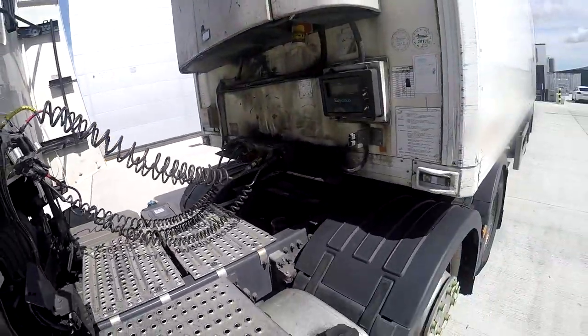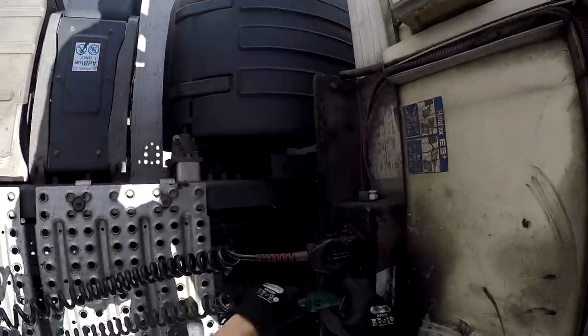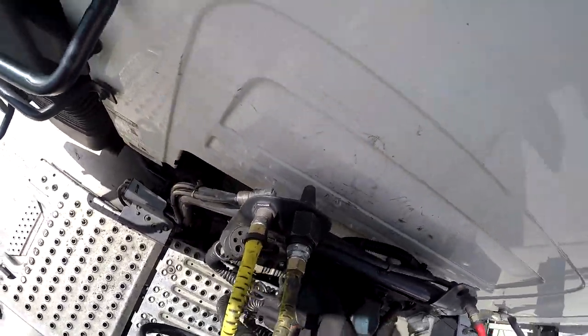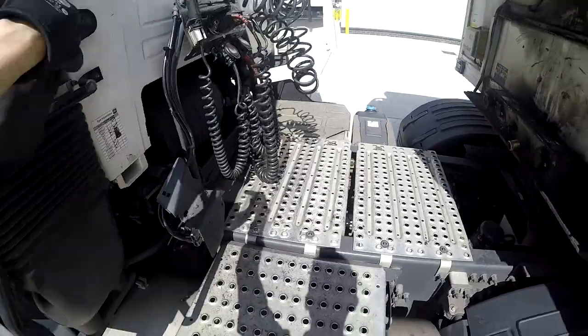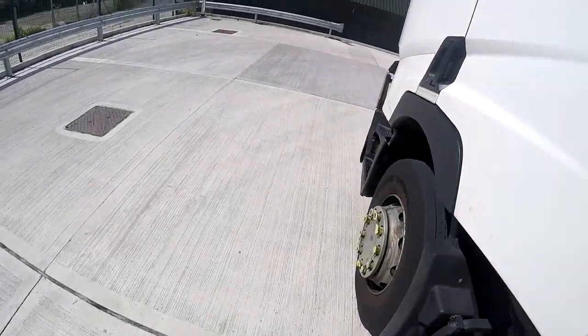Moving around — got the airlines next. So: brakes, legs, airlines. Like I said, it's not a split couple, this is just an ordinary uncouple because there's plenty of space. But if there wasn't quite as much space, that's when you would do a split couple. You want to put all of the airlines back into the place they're supposed to stay — if you don't, they can fall down in the gaps and cause chaos.